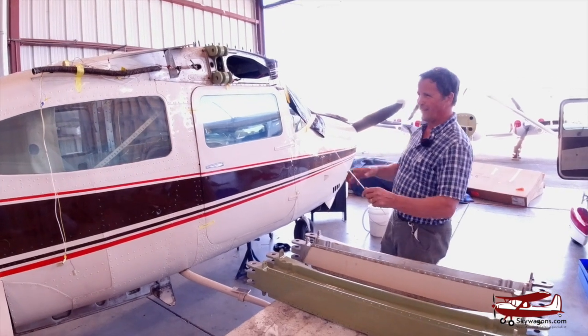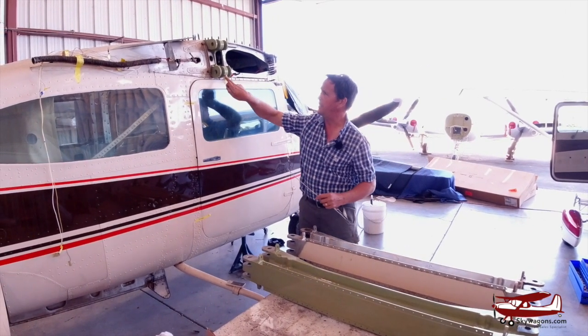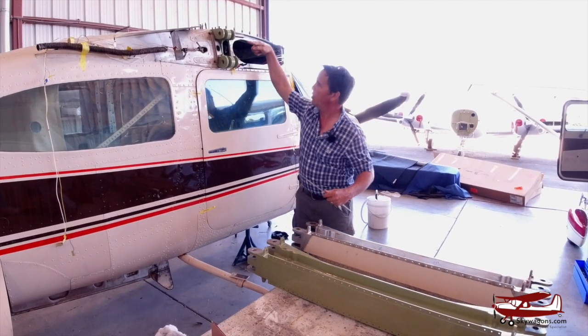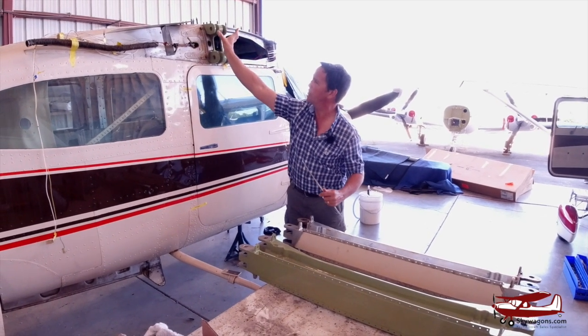This is a 210 — probably a late 70s, early 80s plane. The carry-through spar is this piece. We're looking at the end of these. So there's one in there, and this bolt goes through, the wing goes on it, and there's a little washer on the end of the nut that slides in and holds the whole thing together.